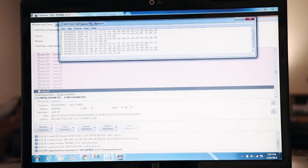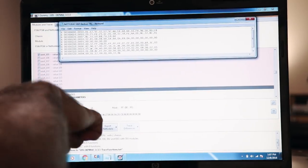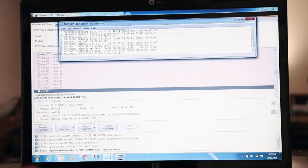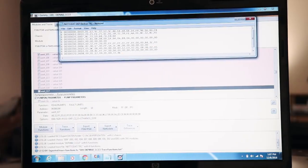Maybe my title seemed a bit clickbaity, but in my opinion, we've hacked the ECU. This was never kind of meant to be this way. We're getting a hint from a preset value because they just happened to randomly make a version of this car meant to run on a high ethanol content for a niche country like Brazil. But you know what? That tells me what I need. It's compatible data. You're basically saying, FF, go all the way to 255. Let's not even worry about the fault anymore.